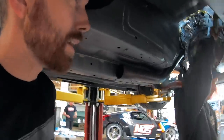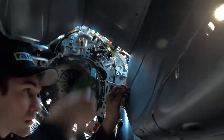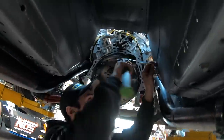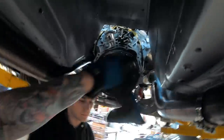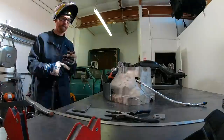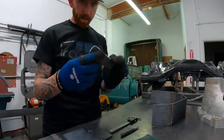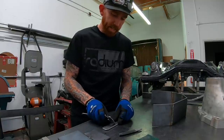The top ring is just about ready, so Billy is about to sink a couple of nutserts into the transmission tunnel so we have something to bolt to. We have to get this thing fixed in some capacity before we move on because we need to make it two pieces — the upper bolts in and the lower bolts in. Billy's got these cool little weld-certs, small threaded pieces you just pop in and weld right there. Next step is to make little ears, take a caliper, do a quick measurement to find the middle, and just scribe it.